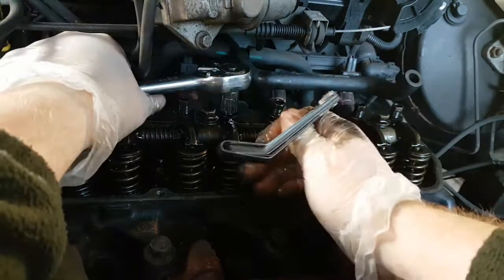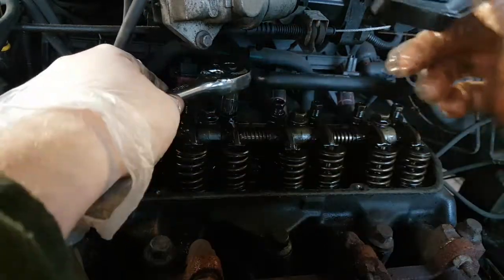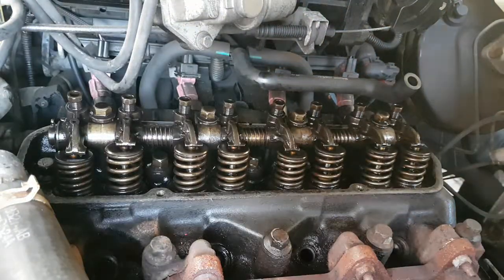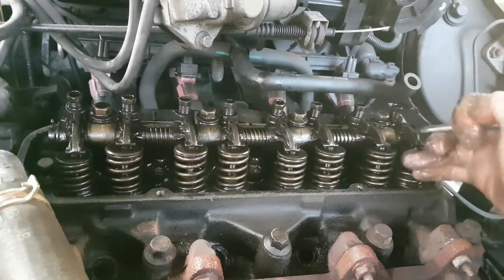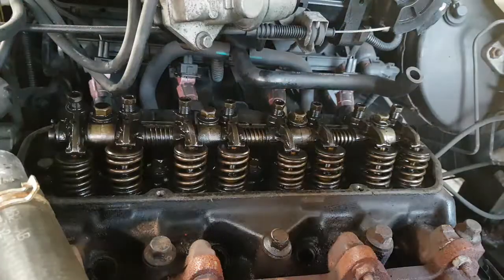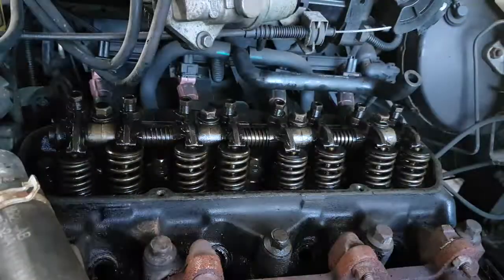That's what we're going to do. Now we've got to tighten them up — that's a little bit tight. There you go, that's better. What you really want to do is mark them once they've been done. I'm just going to use my screwdriver and give them a little scratch on the top. We've got one inlet left. The exhaust one's open, that one's slightly down, this one is open. So we're nearly done.